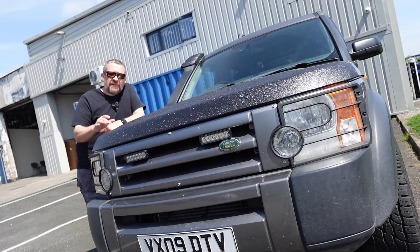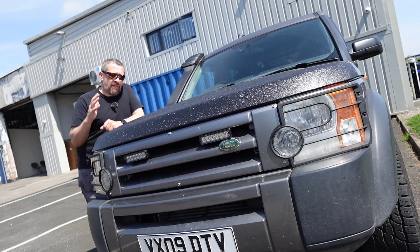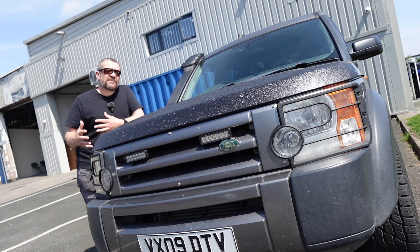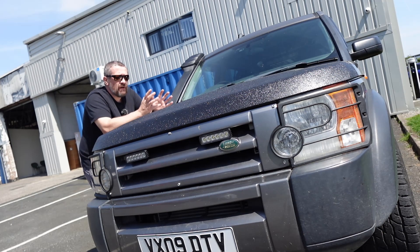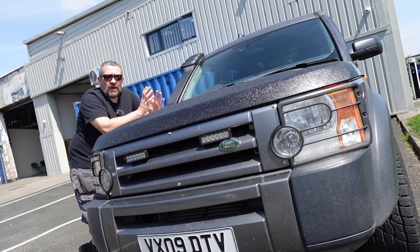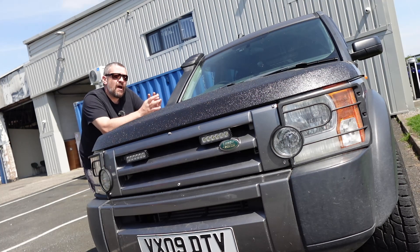It's been a couple of weeks now since I fitted the intercooler and I'm really pleased with the results. I can't say that I've got more power as such, but what I have got is a definite smoother delivery of power - the whole vehicle feels smoother and more relaxed. As far as economy goes, I've definitely seen some improvements: around town I was getting just above 20 to 21 mpg before, and now we're looking at about 23. On a long run - about a 100-mile trip - I was getting about 38 to the gallon, which is definitely about 4 mpg more.